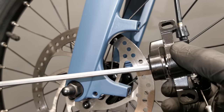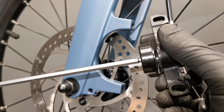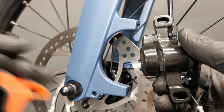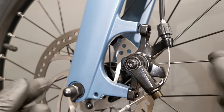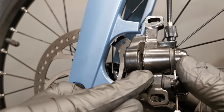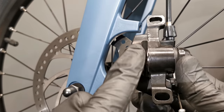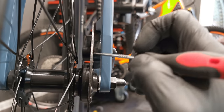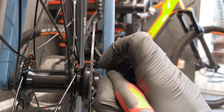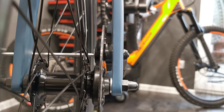You see it goes closer to the rotor and then the gap gets larger. We need to use this when we assemble new braking pads or new brakes, but we also need to readjust it as the rotor and pads wear off, because this is not a self-adjusting system — that's the key point. I want to have the same exact distance between this braking pad and the rotor and this braking pad and the rotor, and that nut is made for that.